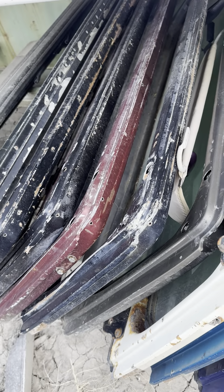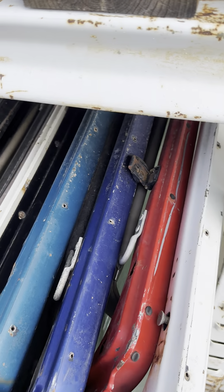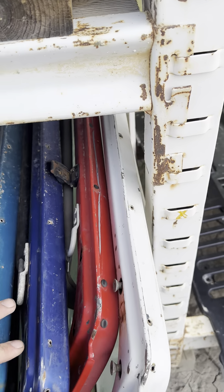You can clean up rust to an extent, but if it gets too bad, you're going to waste yourself time and possibly money — and possibly upset whoever is installing the glass, because they're going to tell you they'll put it in but they won't warranty it. The main reason is they can't seal it properly. All that's to be considered when you're dealing with windshield frames.